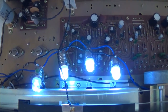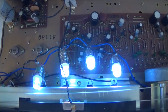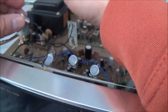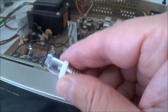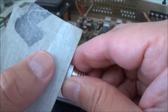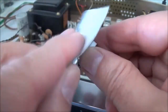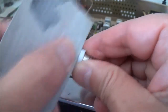The other one on the left is kind of like a flashlight just pointing straight ahead, so it does make a difference. I used 240 grit sandpaper, which is what I had lying around. These bulbs simply screw out. All you do is take the sandpaper and sand it down, and afterwards I just cleaned the residue off with some alcohol, and that is it.